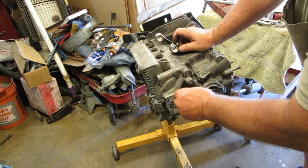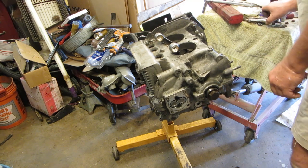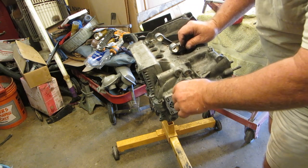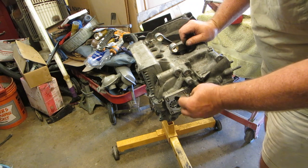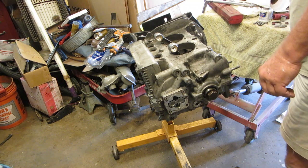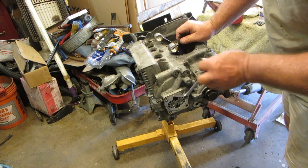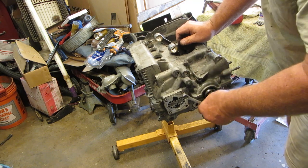I have a couple old engines in the back that I haven't thrown away, a couple old cases, and they're just knackered cases. They're not any good, but the studs are good. So you can take a nut and put another nut on that like that, and then you can thread that stud in. Be careful of your aluminum case on your oil pump. You don't want to scratch that. And you want to get this in there with plenty of meat,